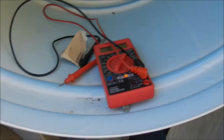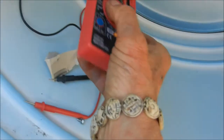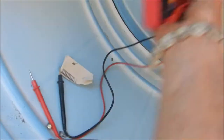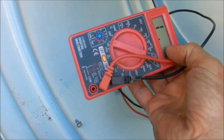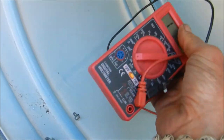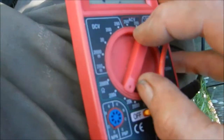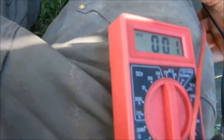What we're going to do is check the heat element. You also want to make sure you have 220 to 240 volts at the socket. To do this, you'll probably need a meter. This is a cheap Harbor Freight voltmeter — you can order them online for about 10 bucks. You want to make sure you set your meter on voltage to 220-250, high voltage.